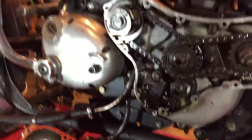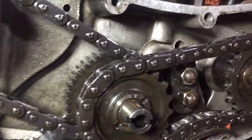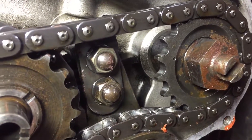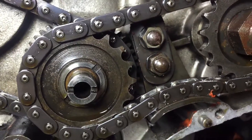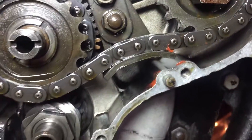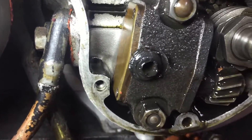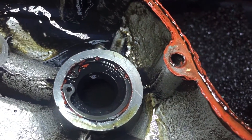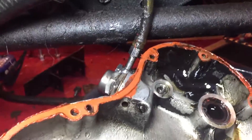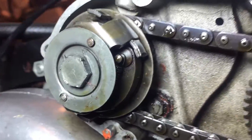Here's a first look inside the case and things seem to be okay. There's some surface rust I can address. The chains seem to be in decent condition. Looking at the gears as well, the teeth on the gears — everything seems to be fine. There's a problem with the seal on the oil pump by the looks of it; it looks a little perished. The spring down here — that circlip has unseated itself, probably was never seated properly in the first place. The auto advance unit seems to be in decent condition; I couldn't quite make out the teeth yet.